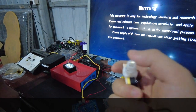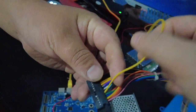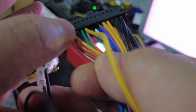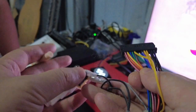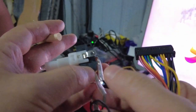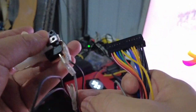There is also the payout button gray wire — the gray wire is this cable. The left one is the gray cable. This gray cable must be cable number five on this connector — one, two, three, four, five — the fifth cable. This fifth cable and this gray cable must be the same cable. It should not be cut in the middle; it must be well connected. The fifth cable and this gray cable must be the same cable.